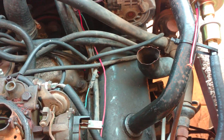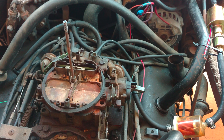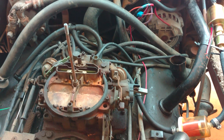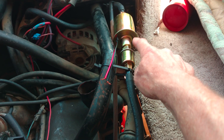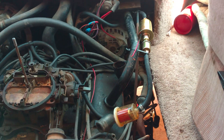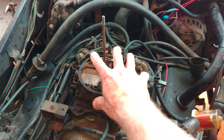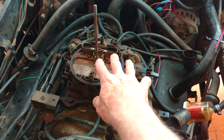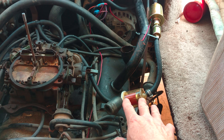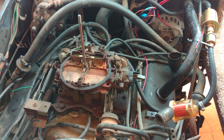This whole system is going to be converted to fuel injection in the future soon, so I don't want to do too much. But if my electric fuel pump in the gas tank fails, I'm just going to take that whole thing out and make it external — add another one of these on the outside of the gas tank instead of internal. I already have the whole MSD fuel injection unit and MSD electronic ignition ready to go. Fuel injection requires a much higher pressure fuel pump, so the whole system will be different. We're switching to fuel injection within a year.